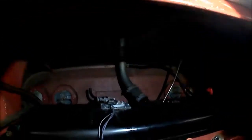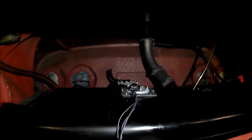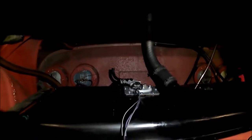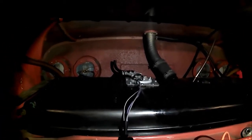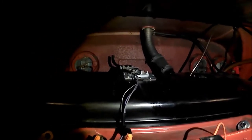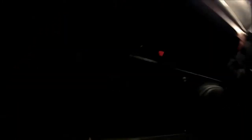The Opels do not have any rear hatch or trunk. Back here we've got a package tray, and back in here you've got your gas tank from the inside. What I've done here — you can see on top — that is a GM fuel assembly unit, so it has a built-in surge tank basically, and an electric fuel pump to run the fuel injection. The reason for that is with the stock gas tank you only have a spot come out the bottom, and any time the gas flushes away from that, you get an air bubble — and that's not good for the fuel injection.